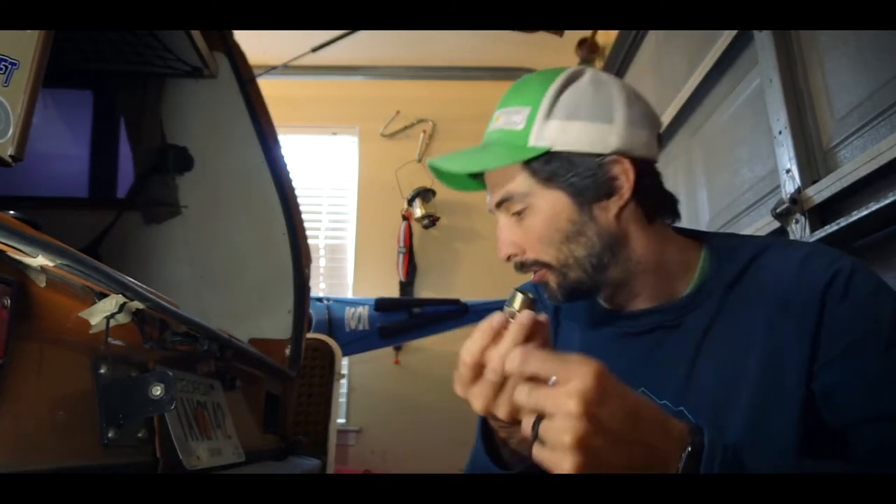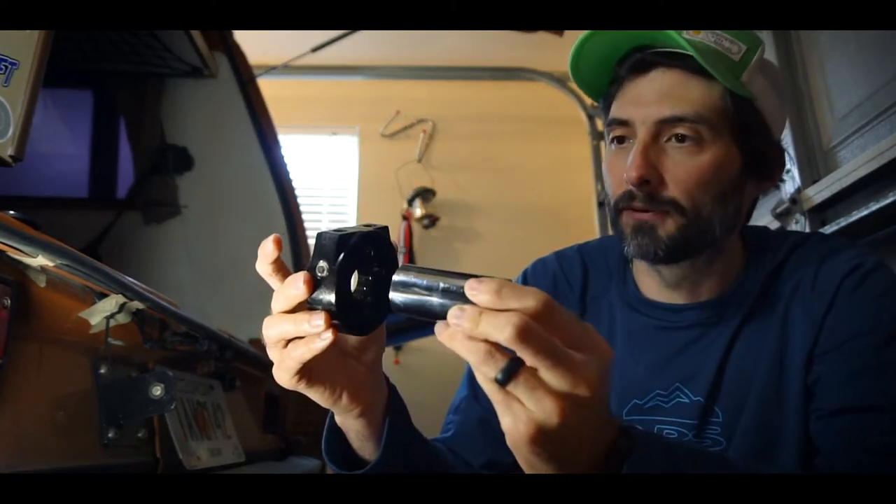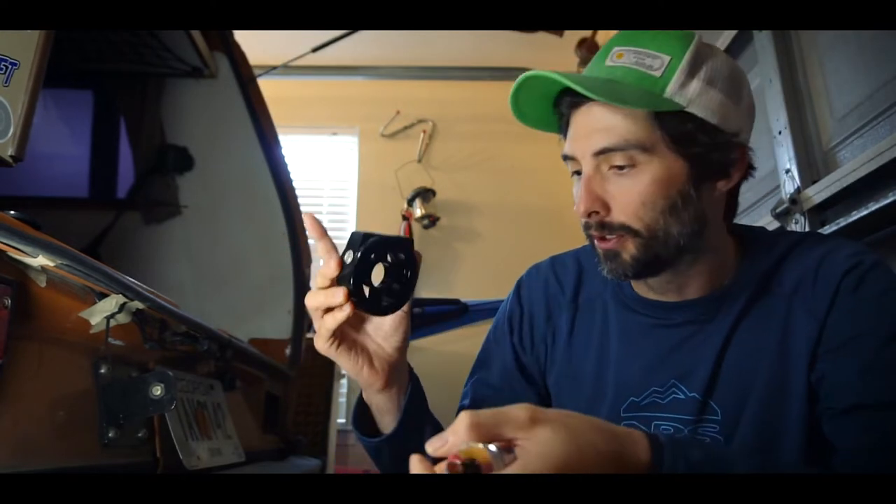The GloShift was a lot easier to do — the actual sandwich adapter had space for you to get something in there to get it tight. But the sandwich adapter for the oil cooler has a spring and a bunch of other stuff in there so that it doesn't send everything through to the oil cooler when the engine is still cold. The idea is once it gets to a certain temperature, the valve opens and sends the oil to get cooled down so it doesn't hurt the engine, and then once it gets too warm it starts cooling it down.